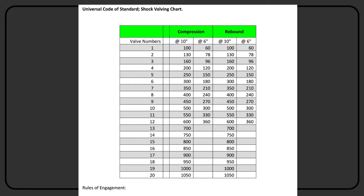It is evened up — compression and rebound. A twin tube shock, or companies like AFCO or PRO, used a different rebound number from compression. The rebound was always higher than compression on a straight valve shock. So if you had a 3, it wasn't 160/160, it was 160/200. This is listed compression then rebound. My suggestion when talking to your shock builder would be to say I want a 3C and a 4R, or a 4R and a 3C. Doesn't matter which way, as long as you specify rebound and compression — call it C, call it R.